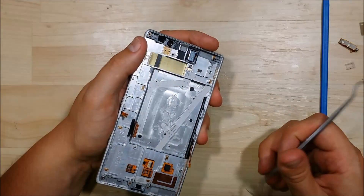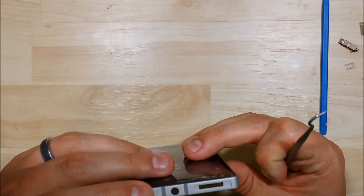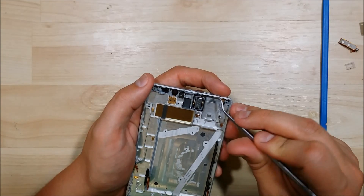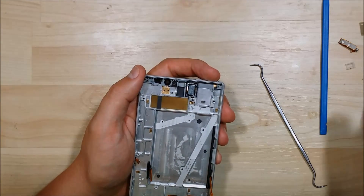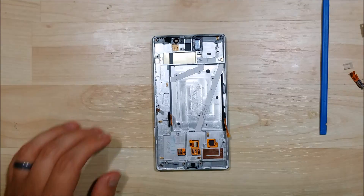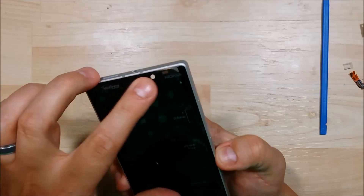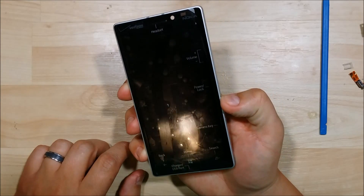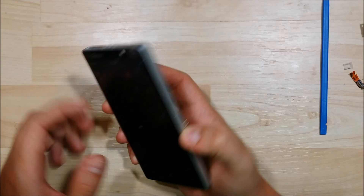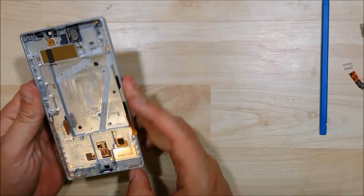Now you could remove this cable — let's just put on a little bit of adhesive. I don't want to do anything that's going to damage this device, so I'm not going to take the LCD off of it. If I do get one that's broken, I'll do it. I know this phone was only used like twice before I purchased it. I'd be really interested to know if the Nokia 930 is similar to this on the inside. I might be getting a broken LCD on a 930, so if I do that, I'll definitely make a video of replacing the LCD as well. It looks like it's going to be a heat gun based on what I'm seeing from the backside, and then a couple pry tools — you can pull it right off, just like replacing the screen on any other Galaxy phone.